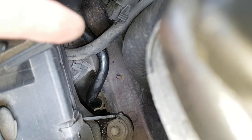Well, there we go then. That's about it for timing chain guides. As I have to reiterate, because I have to do that hundreds of times: oil changes, very important. Don't go too long without oil changes, because it just gets the whole system gummed up and then all sorts of things go wrong. Timing chain guides will fail. You start burning oil. You have all sorts of problems. Your vanos will stop turning as well.